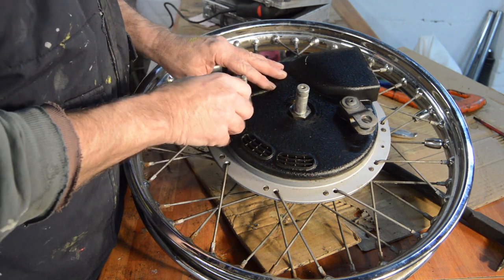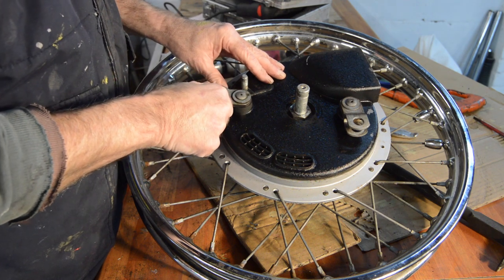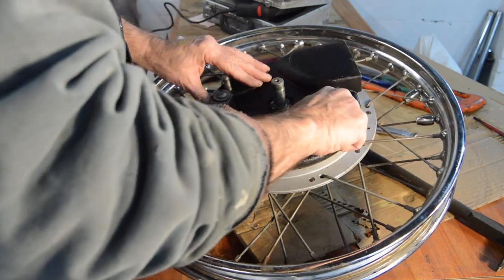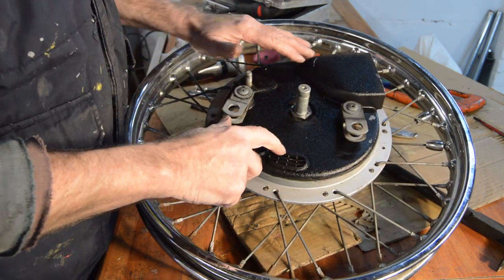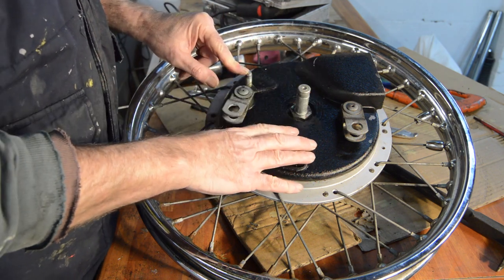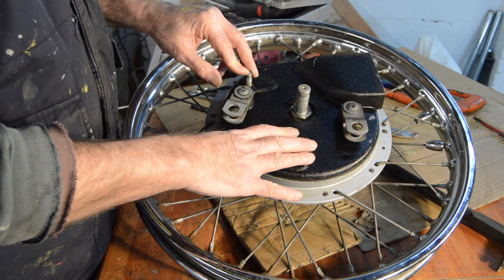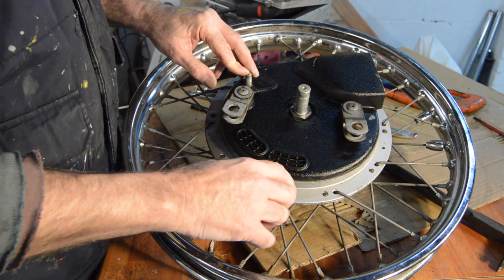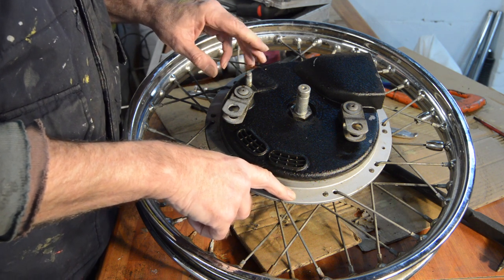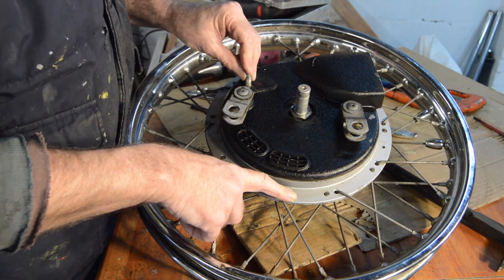These brakes, not sure it's meant to do that either. Surely anyway, we shall see when we open up. These brakes will contain asbestos. So I will take the back plate off and immediately take it outside and clean it off with the brake cleaner. Same with the hub, the drum. Can you see my breath in the video?